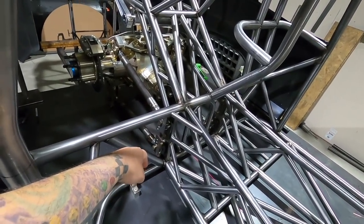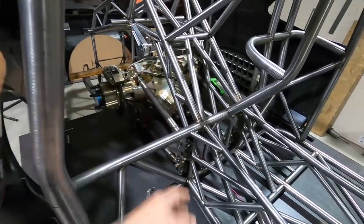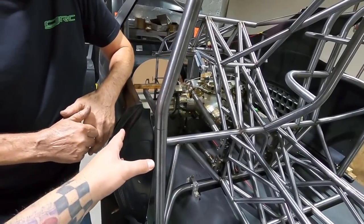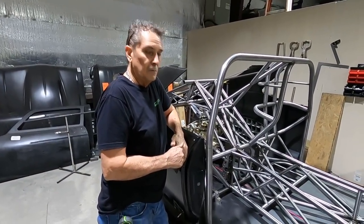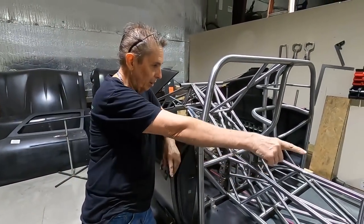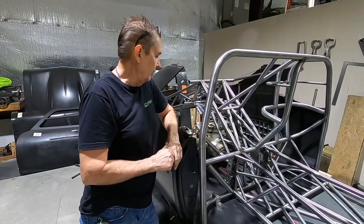Depending on your four-link brackets and where your four-link goes — we run a 21-inch four-link bar, though some people run them shorter or longer — we come up with all the measurements to figure out where the center of the rear end is. The center of the rear end does change, but the cross member placement on our jig does not. Once you figure that out, that determines where the body goes. The number-one bar is the cross member, which goes in on the driver's side across and out — it just gets cut off later.